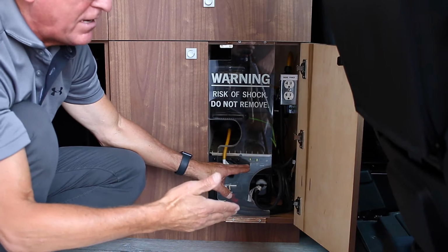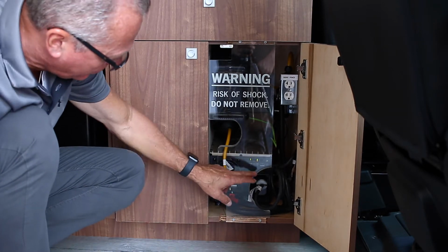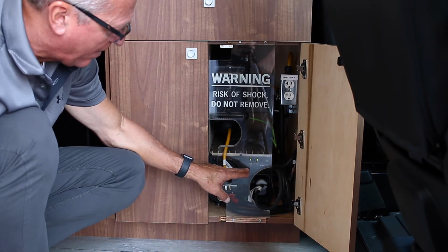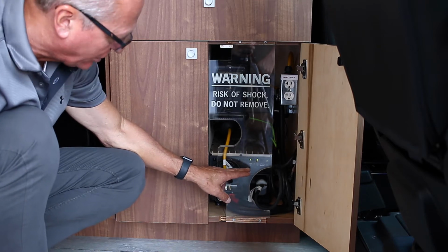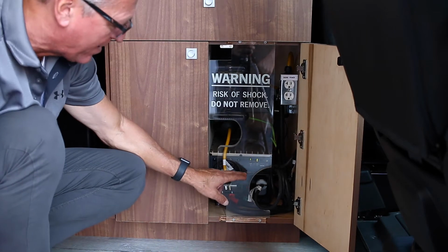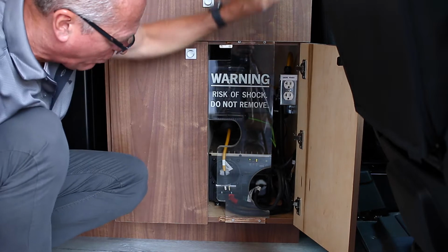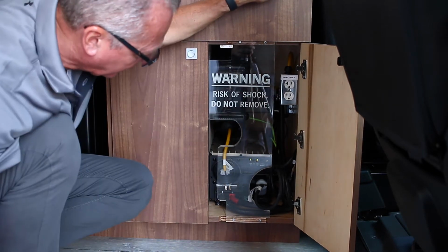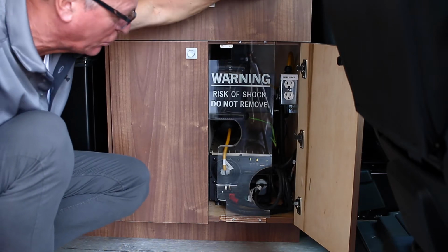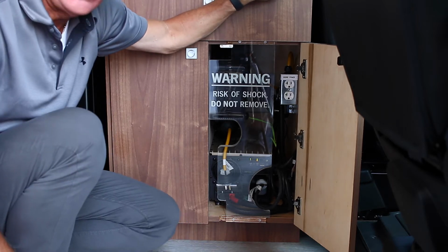your alternator is feeding the battery, and your alternator can't keep up with the power consumption it's trying to use. So if that gets into the red zone, you possibly are getting into an area where the air conditioning is actually going to kick off, because it's not enough. It wants to keep enough power in the battery so you can still start the van, so it just goes into like a limp mode. Right now we're still okay, though. It shows yellow, basically just saying that we're consuming power. So if that does happen, what you'd want to do is shut the AC off for a while, and maybe you can cycle it back on again in a little bit.